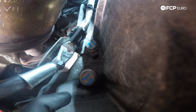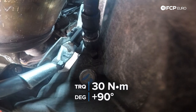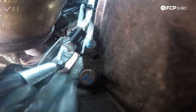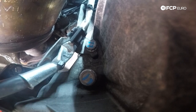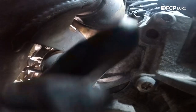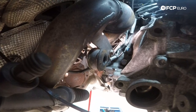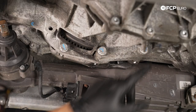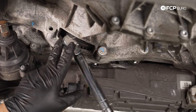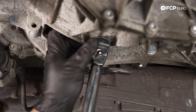It's not a lot of torque so I'm not worried about them coming loose, and I don't want to over-torque them and snap them as they are delicate aluminum bolts. These top two 18-millimeter 12-points are going to be torqued down to 30 newton meters plus an additional 90 degrees — same as the top bell housing bolts. We have one more down below, same deal — tighten it down to 30 then an additional 90.